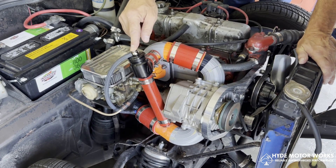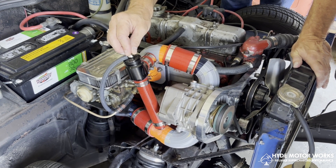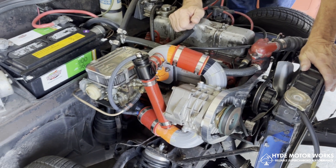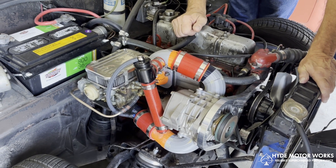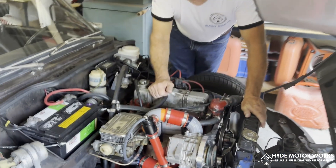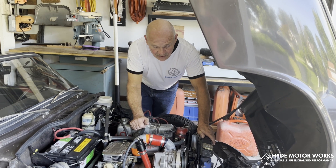This is our vacuum that controls atmospheric pressure coming off the bottom tube, and we will adjust it to control how much PSI goes through for the charge. On the manifold itself, we have a vacuum line that goes inside to a boost gauge so you know what boost you're running. On this small of an engine you're going to want to know how much boost you're putting in so the engine stays in one piece. That will be included in the kit and we strongly suggest you use it — with it we will be fine as long as we keep an eye on our boost.